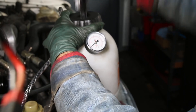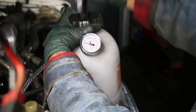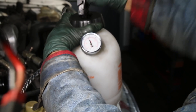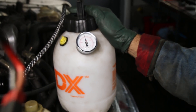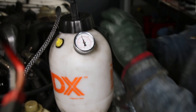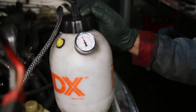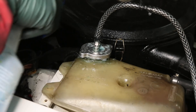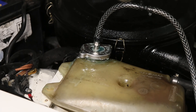It's coming up faster than the other fitting — five pounds, almost 10 pounds. Let's take it up to about 12 to 15 PSI. We've got coolant dripping on the floor — it's still leaking. We're going to spray it with our leak tester spray, check underneath for bubbles. No leak — that's pretty amazing. Happy new year and a very merry Christmas!